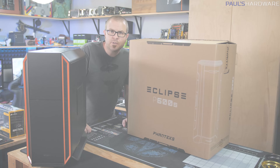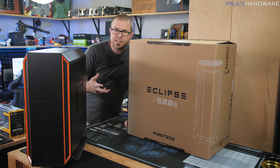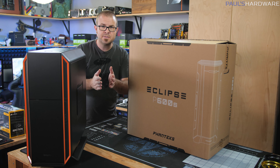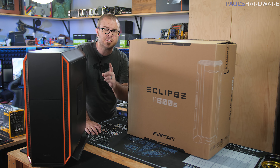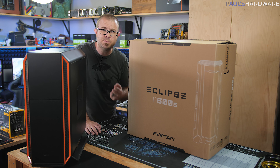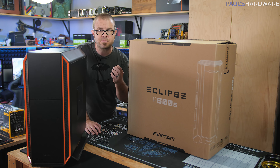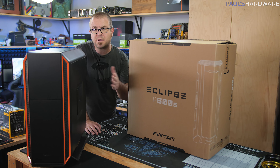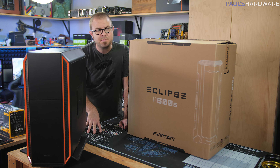We've already made a lot of progress just getting the table cleaned off, getting some stuff sorted away — lots of remnants of old builds sitting around that I needed to sort and put away in a more efficient manner. Moving on to the secondary goal of this video: building an updated system for Joe, because currently he is using a system based on an Intel Core i7 6800K, which is a 6-core 12-thread processor. There's just a lot more CPU compute horsepower out there, and Joe does a lot of work with his CPU. Video transcoding in particular is really CPU intensive, and he does proxies for just about all the videos he edits. It is supposed to be more of an editing system than a gaming system.